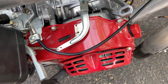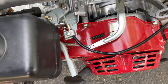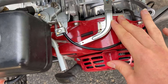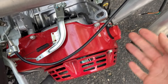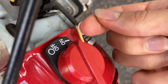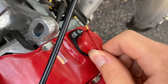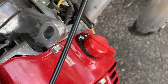Maybe I'll try and find a little animation to put at the end of this video to explain it a little further, since none of this you can actually see. But it is quite simple. Really all the kill switch does is disrupt the connection. In this case, it's basically disrupting the connection of that positive wire that runs underneath here and goes to the magneto. When it's on, it just touches those two wires together. When it's off, it basically disrupts that connection.